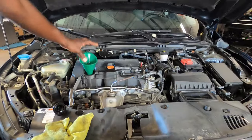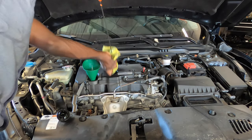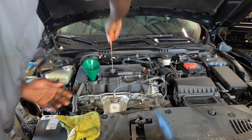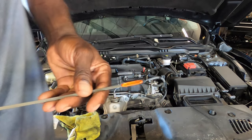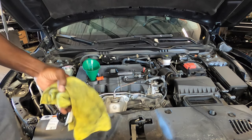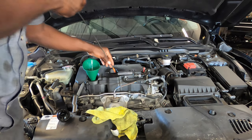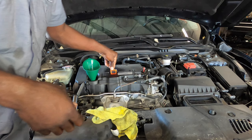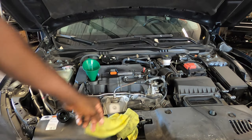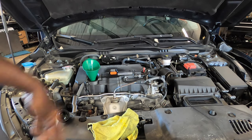After you put oil in the system, pull the dipstick out, wipe it off, put it back in, and make sure it's at the correct mark. After that, go ahead and start the vehicle. Let it run for a bit so the oil fills the filter up, then let it sit for about three minutes and repeat that dipstick check.